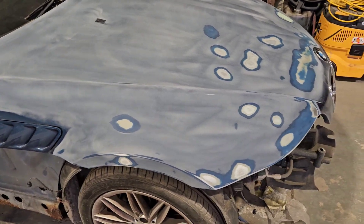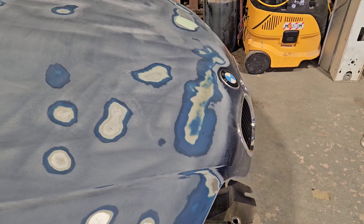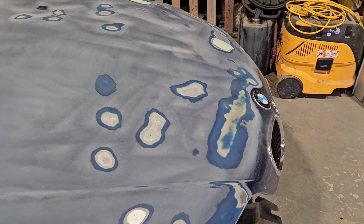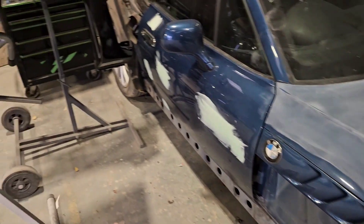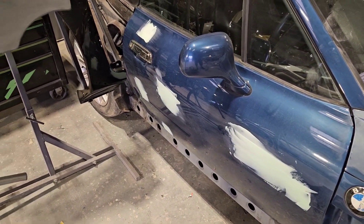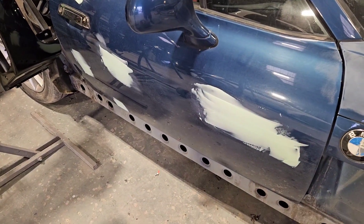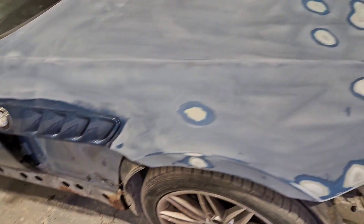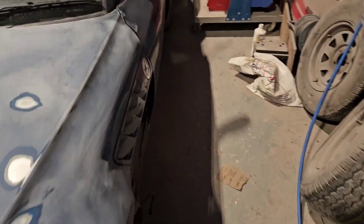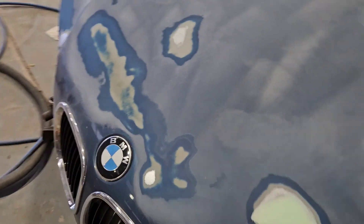What we've done is basically just go over the bonnet - any wee chips, marks, scrapes, we went over it with 320 DA pads. Any wee dents on the door, I've sorted those out. And anywhere where there's a wee mark I have put filler on it for now. Also going to move it out here and get this other door done. So we'll come back and show you the parts that have got done and prepped, and we'll go through the different layers of repair we're going to do to it.